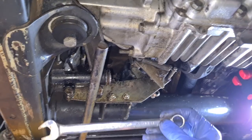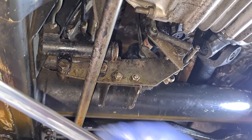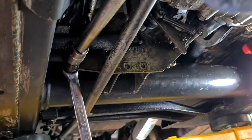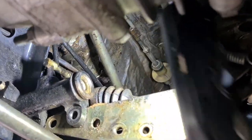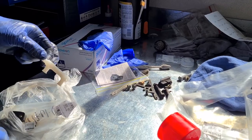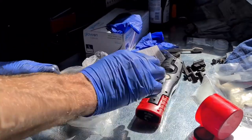Using a 13mm I'm just taking off the two brackets on the spring mounting bracket, then 17mm to disconnect the actual two master cylinders and take that whole bracket out. It's not difficult to put in and out and its removal very much simplifies access to everything. You can see everything sort of disconnected now. There's that F-piece — the plastic tubing where your brake reservoir fluid feeds in. I've got a new one; they can reportedly snap, though that was not my problem, but I had one purchased anyway.